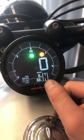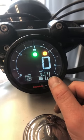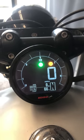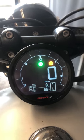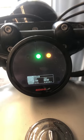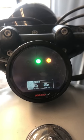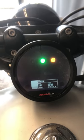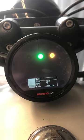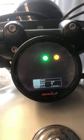And then we're back to the odometer screen. We do have a neutral display here, which will read your gear — one through five — and that will be programmable. We'll actually enter the programming mode here; I'm pretty sure this is by holding Select. When you hold Select you'll see we go into the first menu, which is the clock, so we can choose the units and such. Press Select again — if we want to go into this menu we press and hold Select but we're going to skip it. We can also set the units here for speed as well as temperature.